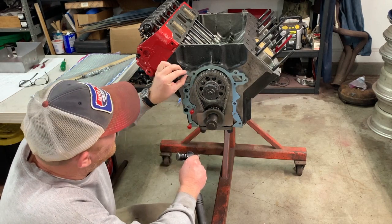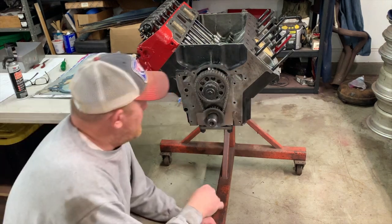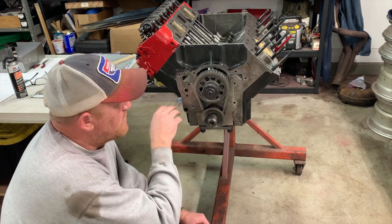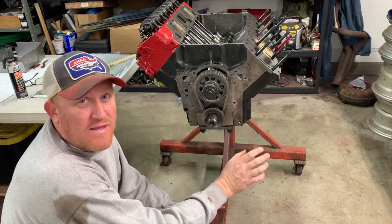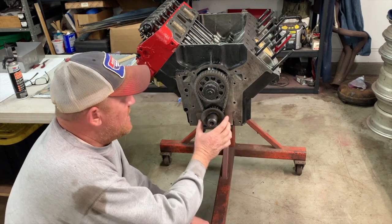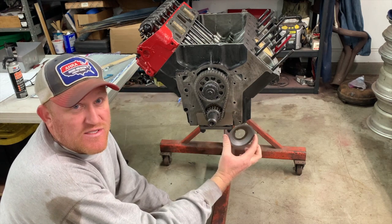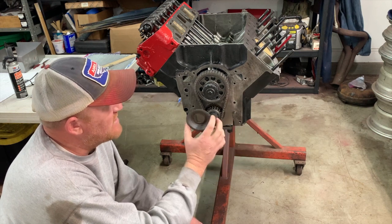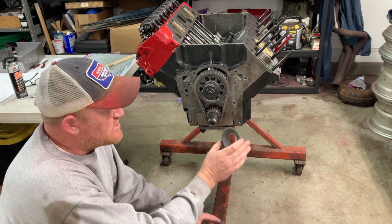You can see now the holes are opened up to the size we need. With the gaskets opened up and holes cleaned out, we're getting ready to assemble the timing cover. One quick thing before we get any further - your oil slinger. On a Buick you have to put this in; there's no way to put it in after you've put the motor together. You'd have to take the timing cover back off, which includes the bolts and the oil pan - it's just a pain. Never forget this thing.